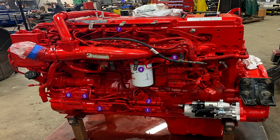On the ISX-15, the fuel system is on the driver's side of the engine, or the left side. We always view the engine from the flywheel housing looking forward. Number one is the fuel inlet manifold — there is a check valve in there. Number two is the electric lift pump that will prime your filter and system. Number three is a low pressure gear pump that builds approximately 185 PSI in the fuel system. Number four is your low pressure fuel filter. Number five is the fuel control housing that the fuel actuator bolts into, which bolts to the back of the high pressure pump head. Number six is the high pressure pump head. Number seven is the common rail. And number eight is the fuel return manifold.